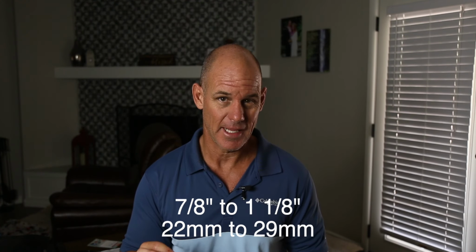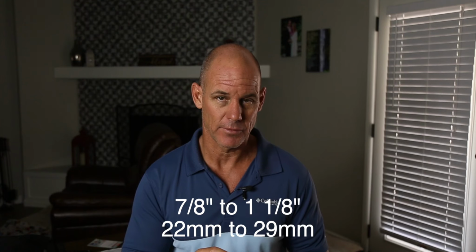And with the fronts, my plan is to put it on jack stands and then just jack up underneath the suspension to weight it, loosen up the two lower torque bolts, because I just cannot get to those when the car is on the ground, and then retorque them, drive around a little bit more for a couple days, and then get it aligned. But as far as numbers go, essentially I'm still about an inch and an eighth higher in the rear than I am in the front.